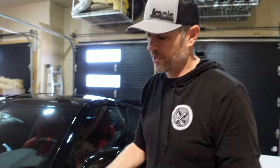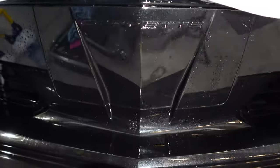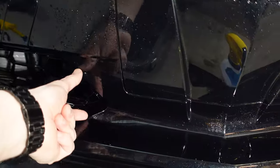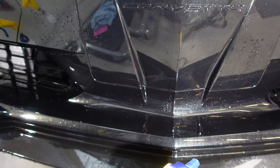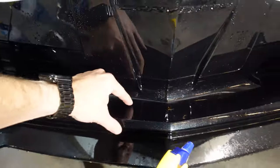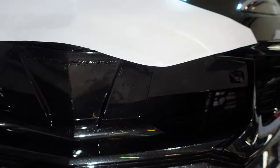And that's why we use paint protection film — the paint is brand new, protected. All of these pieces are laid in; I did some off-camera beforehand. We're just waiting for it to dry so we can double check all of our edges. Now we're going to install this piece right here that goes underneath the pieces we just did. We'll do that next and then we'll be done with most of this front end. I just need a piece for here — I don't know if I'll get to it in this video, but I wanted to show you exactly what these smaller pieces look like first.